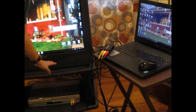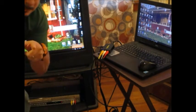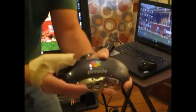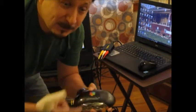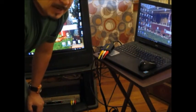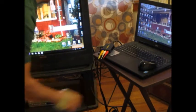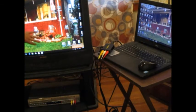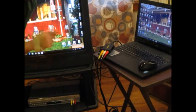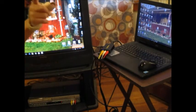Here's how I get this to record back on my laptop — that'll be Part 2. You go from the output on the VCR into your Pinnacle box, and from the Pinnacle box you go back into your laptop. Either way, this is how to plug your laptop via HDMI into a TV with RCA. Even on newer flat-screen TVs that have RCA, your laptop screen will show up much bigger. It looks a bit rough on this old tube TV, but it works. VCRs are a thing of the past, but they have input/output, so you can use them.